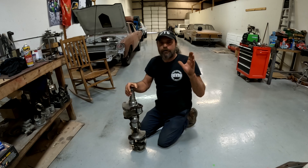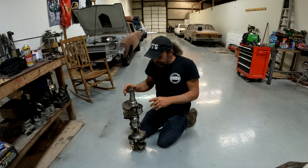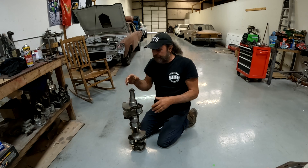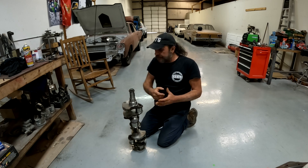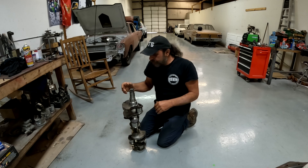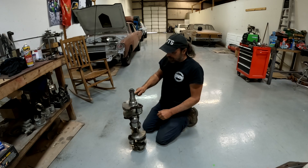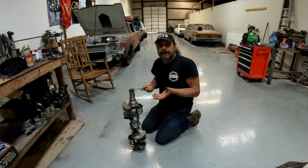Listen to this — after the thud there was a ring. This crank rings. When a crankshaft cracks, it's generally because all of the springiness is out of it. The crank by its nature has to have spring-like qualities because of all the different forces on it — the torsional twisting, the impacts from the combustion process, all the vibration and fine harmonics. If it's not spring-like, it'll crack.